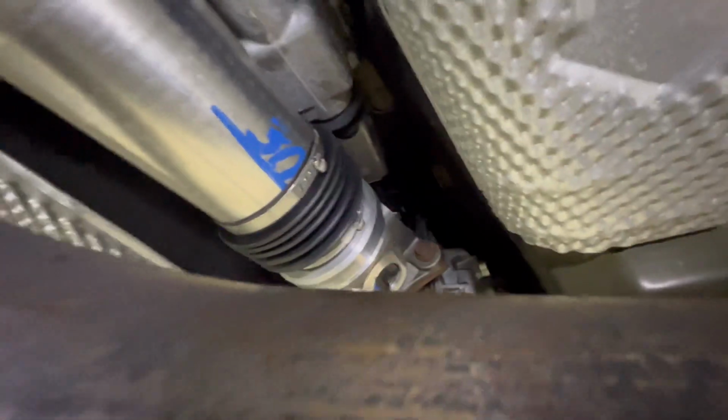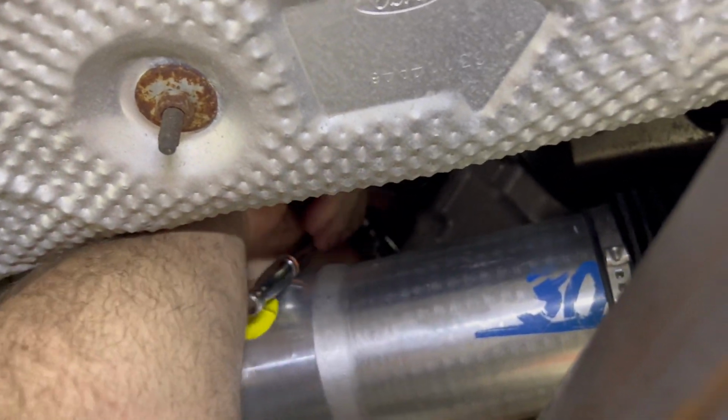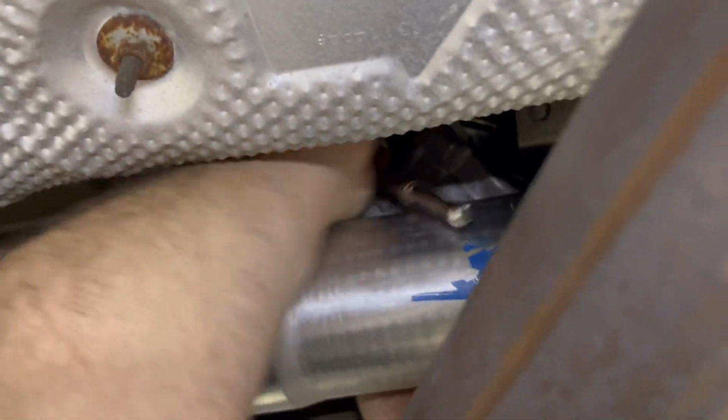So now I can get to the bolt that goes on the top side there for the upper linkage, and I should be able to pull the shifter assembly out, hopefully. Now with Sean here demonstrating, essentially I'm taking that last 10 mil off, it's gonna get through the hole after dropping the shifter linkage down from the back of the transmission. So now you can really get access to that bolt, break it free, and take it off, and you can pull the shifter assembly apart.